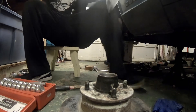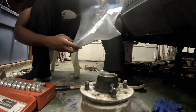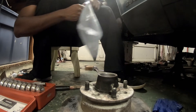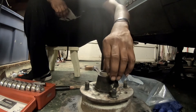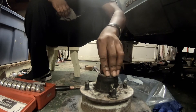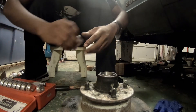Now that I've got a nice seat — here are our races, nice and frozen. I put these in the freezer because what that does is it makes the metal contract and shrink just a little bit. The tolerance on these things is very low, so just that little bit can do a lot for you — can make putting these things in a lot easier.